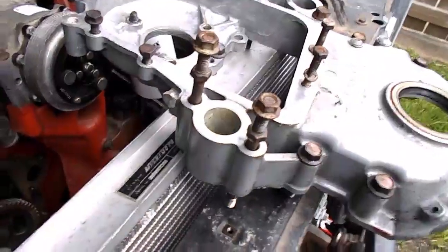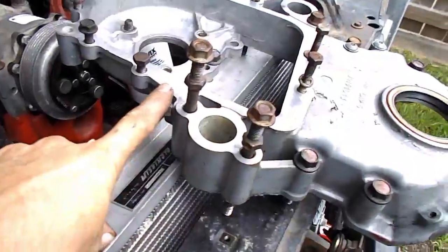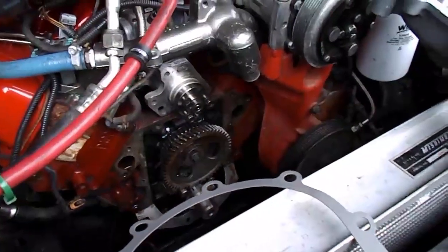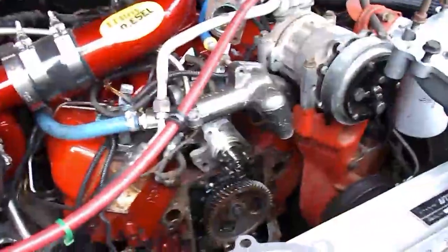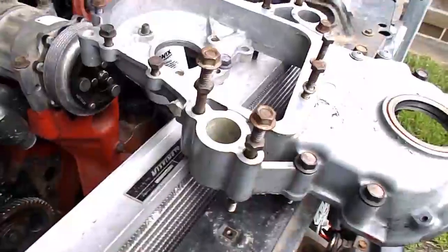If you're interested in a bypass filtration system, let me know. The return would come in here and hopefully shoot out under a little pressure, which would actually run and lubricate all the timing gears. They should get plenty of oil anyway because right here and here are the spill-back ports from the engine valley where the lifters and push rods are.